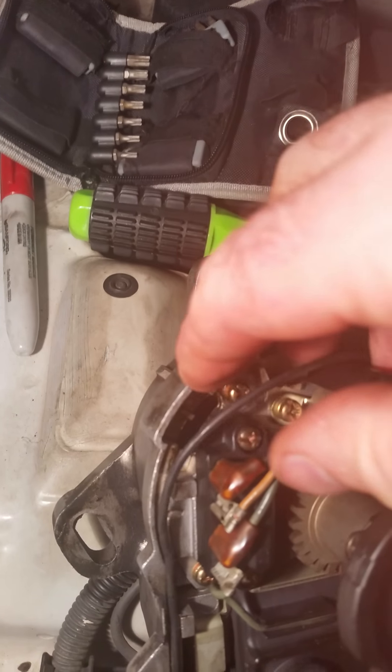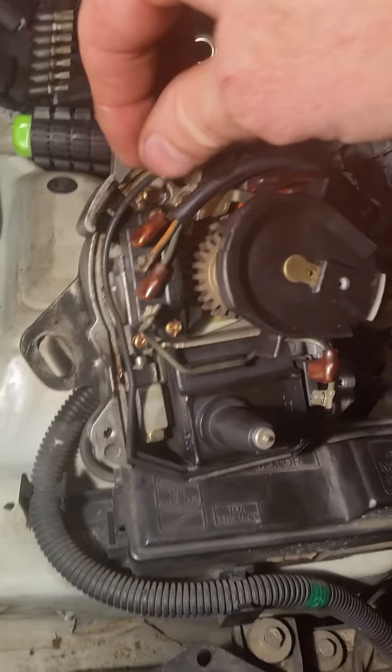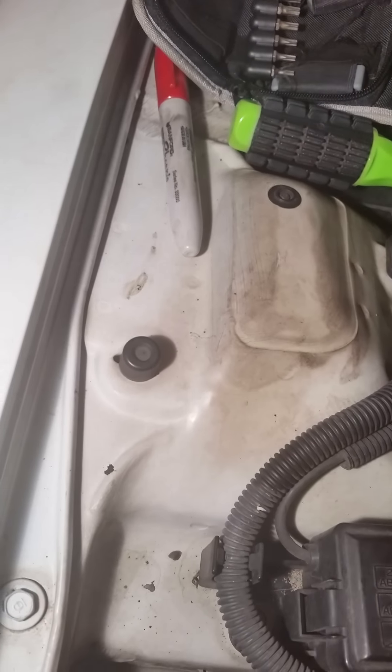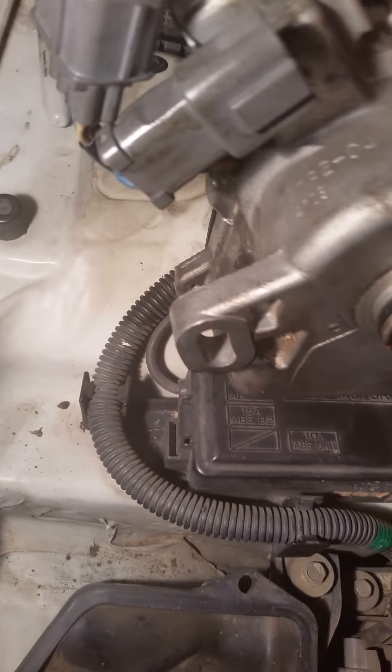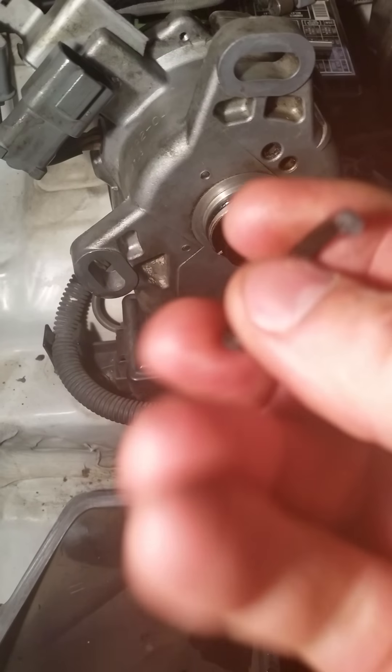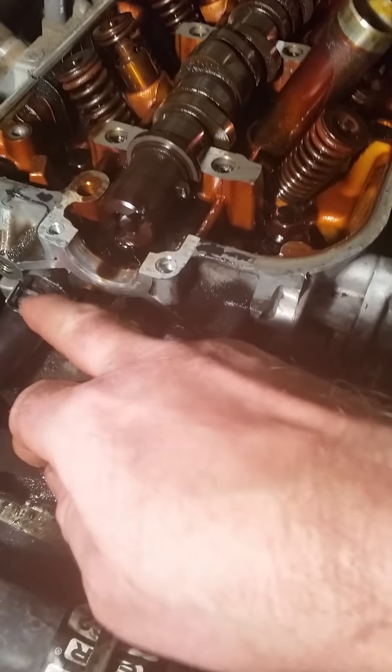See how this little gasket right here was left loose, hanging out? All this oil and stuff is all up in here — I've cleaned a bunch of it off. The oil was leaking out because this o-ring had gotten really brittle. See, here it is — it just breaks like that. This o-ring fits in this channel right here and was letting oil drip down.